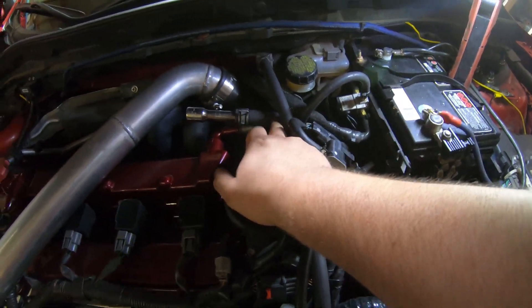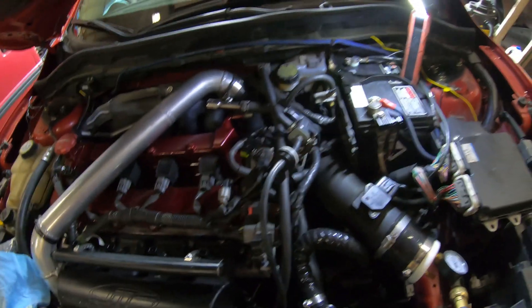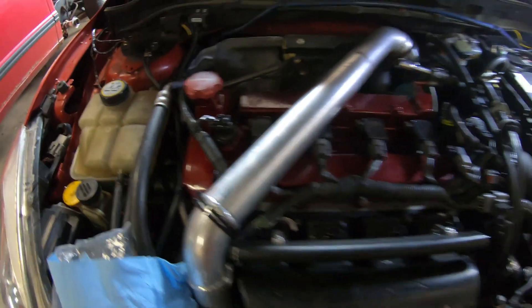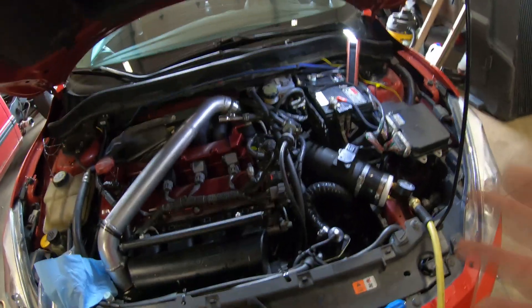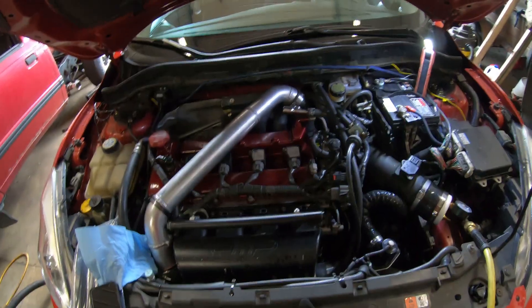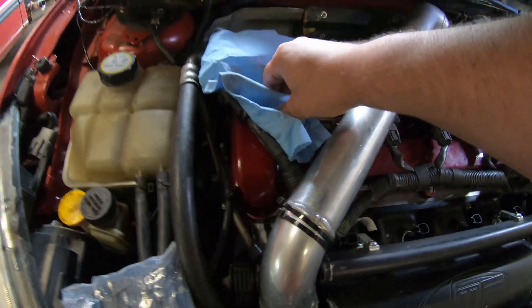I also left the valve cover connected — the PCV vent — which a lot of people have deleted. I had that plugged in while boost leak testing, and I was getting a leak from the VVT solenoid. That is not supposed to see boost. Unless something is seriously broken, it should not be leaking boost at all. I'm hoping I didn't pop the seal on it — but it's cheap, so I'm going to replace that too.